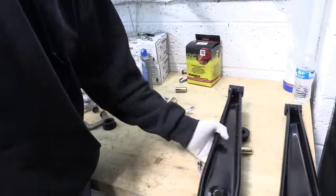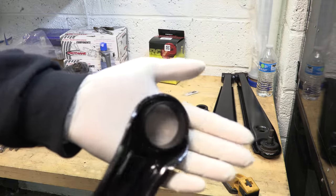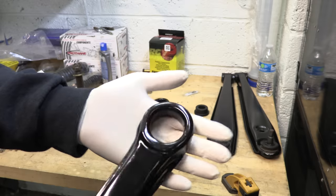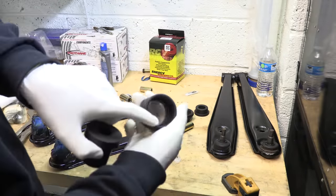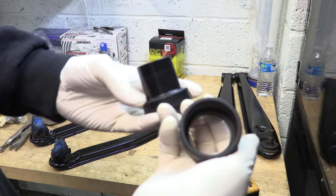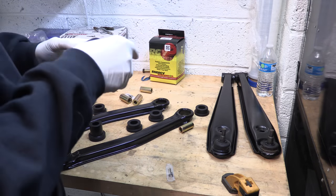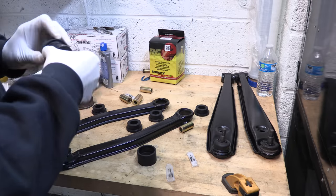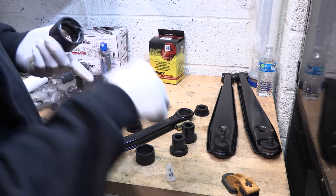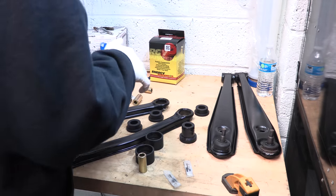The torch is really unnecessary, but we love a good fire. All of the bushings in your set are made for specific joints — sometimes they only fit one way, making things really easy. The arm has a lip pressed in one direction and the bushing has a groove to receive it; that's how you know which way it goes. The outer bushing is cut the opposite way to mate up and support every single surface around the mating points when pressed together. But first, lubricate the heck out of everything before you put it together. The lube serves at least three purposes: it keeps your suspension from squeaking, keeps the moisture out, and makes assembly easier. If you're struggling, you didn't use enough.